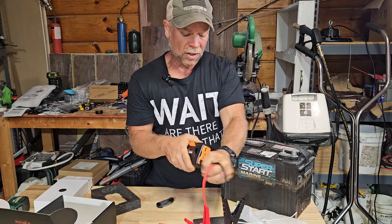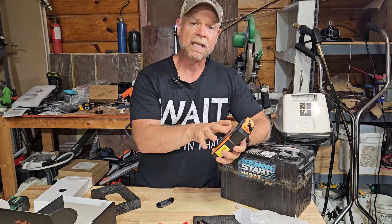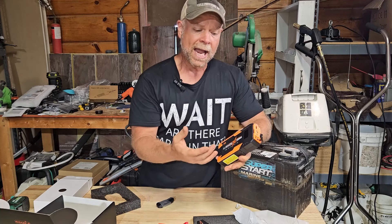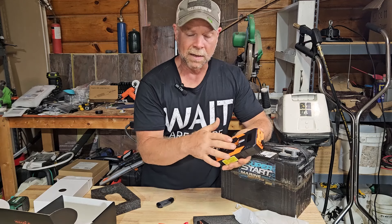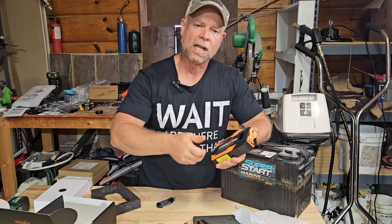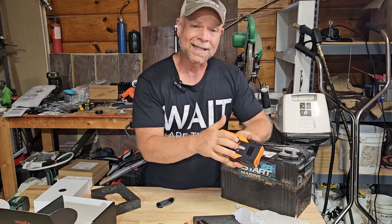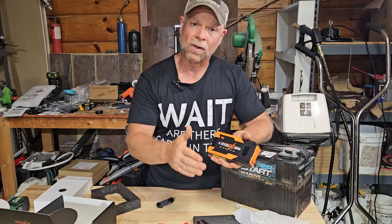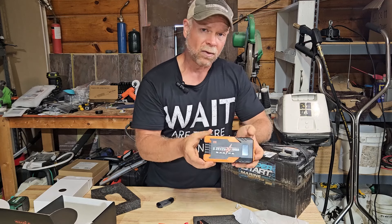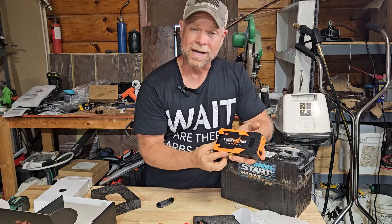These are super handy, really nice devices. I think every vehicle should have one of these. They are replacing jumper cables simply because of their convenience, small size, ease of use, and they're harmless to use. It doesn't hurt the jump pack and you don't hurt your battery unless you are overloading it by continuously turning the key over on a dead battery. So 1600 peak amps is going to get just about every vehicle up to a 7.2 liter gas engine or 5.5 liter diesel engine. Every vehicle needs to have one, and I think if you were to purchase this one, you would not be disappointed.